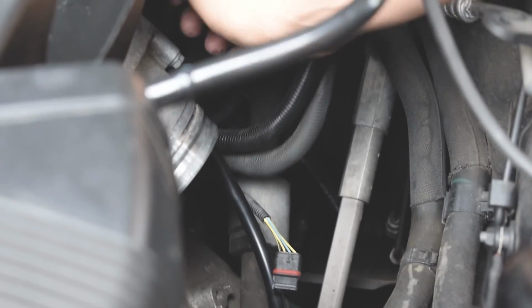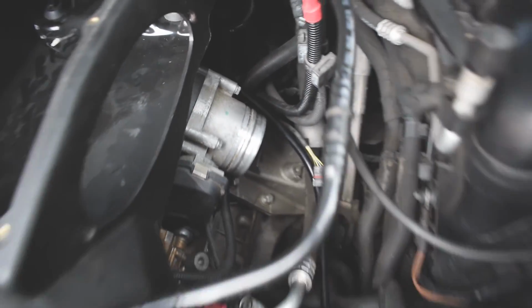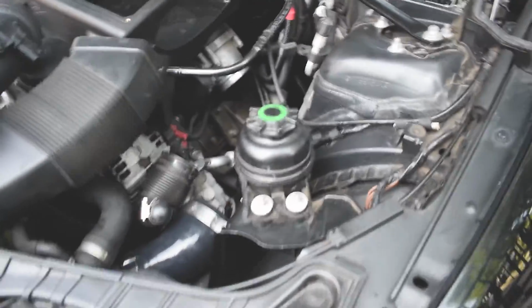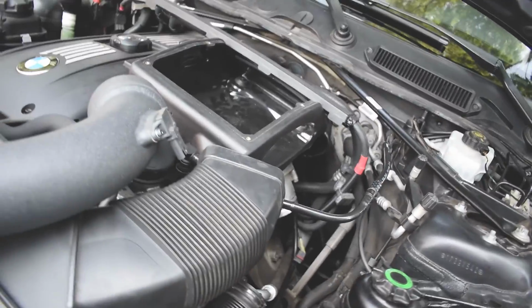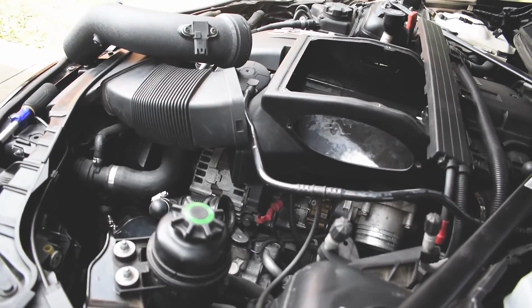What are you doing right now? Installing a vacuum line. It connects right up next to the throttle, right there on the right side of it, and you gotta connect it to the charge pipe. Do you have to cut it or no? I don't think it's mandatory. It's just gonna go on the intake. Not the intake, charge pipe. Charge pipe. Blow off. Oh, okay.